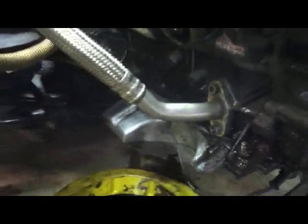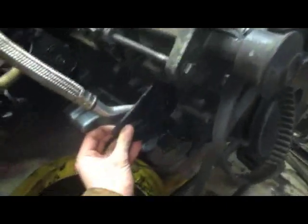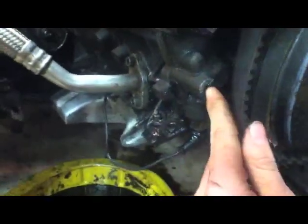I'm thinking I'm probably going to have to deal with the AC compressor. Normally this bracket right here is for the AC compressor — that's where it normally goes. But I was able to pull it out far enough, and there's luckily enough slack in this hose here which runs over to the other side. If I can fabricate some kind of extension to push the whole assembly over, I'm 90% sure I can make it fit.